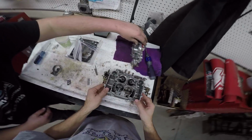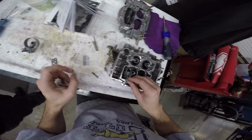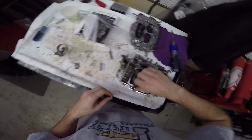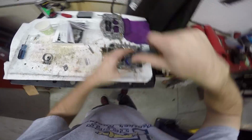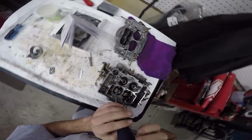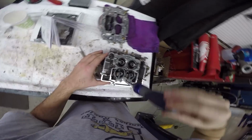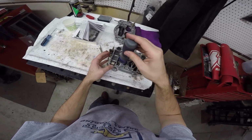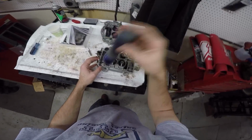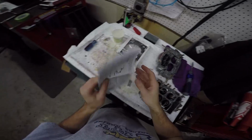Everything's there for it, but nothing that you need to block. Okay. Most of the newer stuff comes with both, and you just block off what you don't need. Looks like you can change jets in here, just like on a bike, if you want to richen it up. I'm just tightening these things, tight but not too tight. I don't think there's torque settings for Venturis. Snug everything up, yeah. Alright.